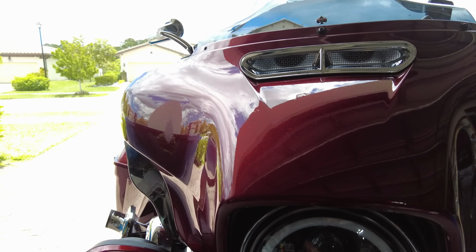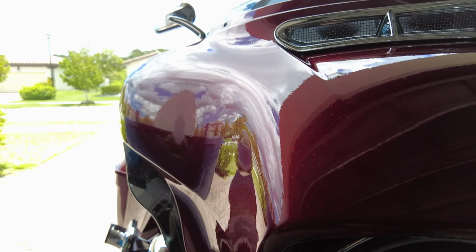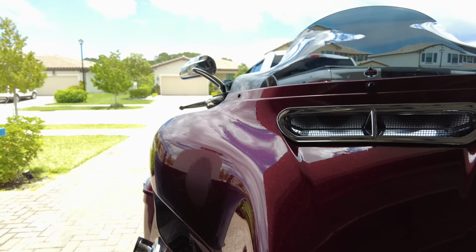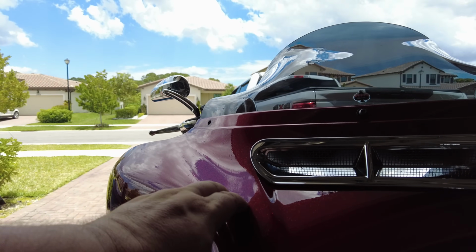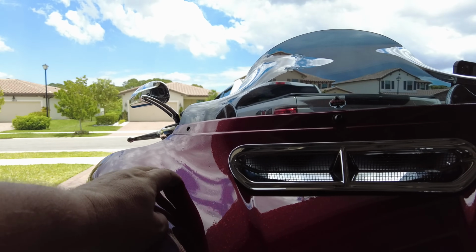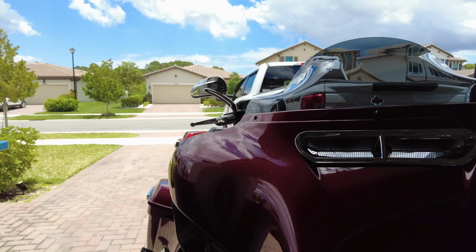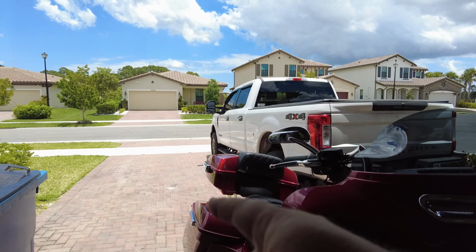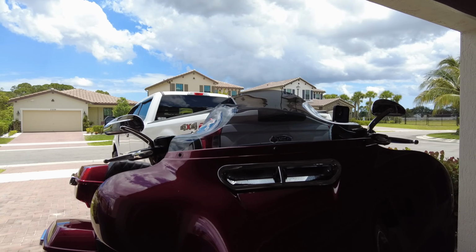I'm going to set it in the sun. I bet that'll take it out, but damn, here, I'll show you what I'm talking about. Not the topic of the video, and I'm not sure that you can see it, maybe. There are divots, not hard divots, but soft spots where the bug's just embedded in the clear. It's just the actual impact. Oh my God, that's awful. Anyway, I don't know what to do about it right now, so I'm going to take the fairing cap off and set it in the sun right there. I bet that'll soften up the clear and make it lay level.